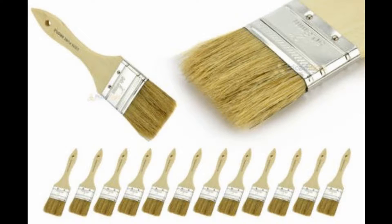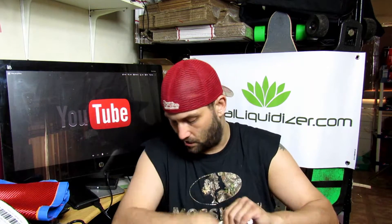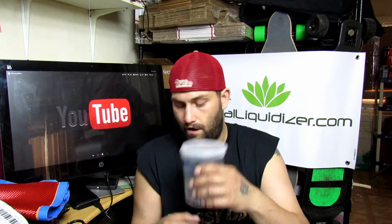Make sure you have the cheap absorbent material as well as the Teflon-coated release film for the finish. Get the big paint brushes — these bristles are nice and firm and will work the resin in. Have plenty of mixing cups on hand. What I like to do is weigh out the two parts, because the system I use requires weighing, not measuring by lines. Put each part to the side, then when ready, combine them. Don't shake it — you'll get air bubbles. Stir and fold it.